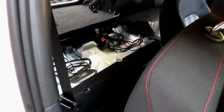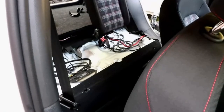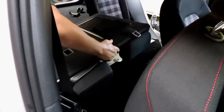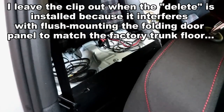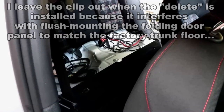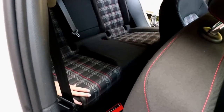It's pretty easy — it all wedges in there and it's pretty secure, but all without tools. I can get this package out of my car in less than five minutes. Putting the rear seat back in will take a little bit more time, but it's not awful. The toughest part is remembering where I left the clip that holds the center hinge for the seat backs in place. Once the seat back is in, I have to secure the pieces that hold the hinges down, secure a seat belt anchor, and then I can grab the seat bottom and put that into place.